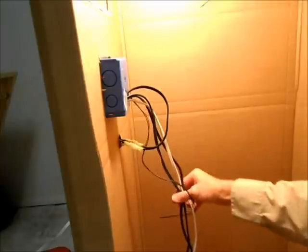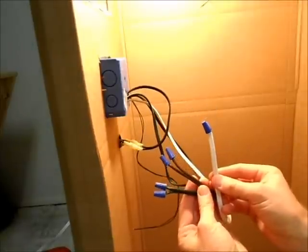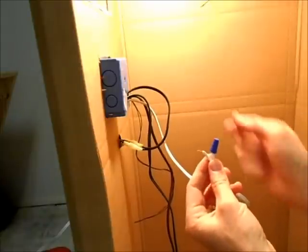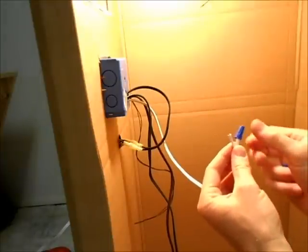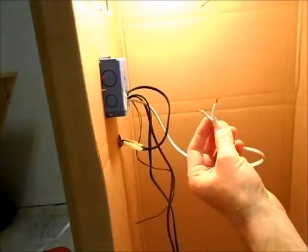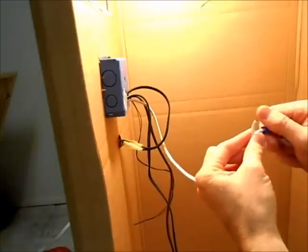When it comes time to wire up the heater, the fan, or the egg turners, follow the color coding in the instructions. Each of these wire ends has wire nuts attached to them — simply undo the wire nuts. Note that I have unplugged this, so there's no power here right now, but be aware that if this is plugged in these will be live wires. Always do your wiring with the power plug unplugged. Simply attach those wires to the accessory you're going to hook up and you're good to go — it's that easy.